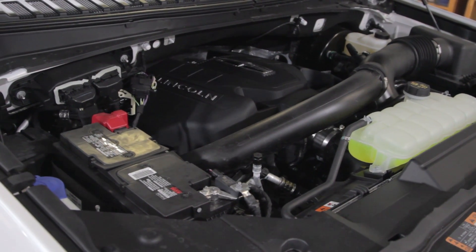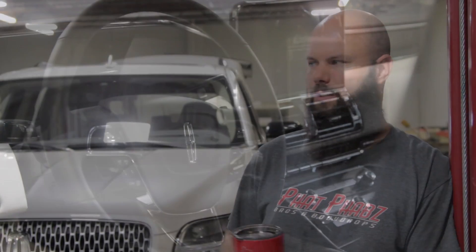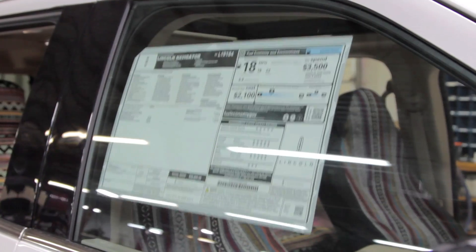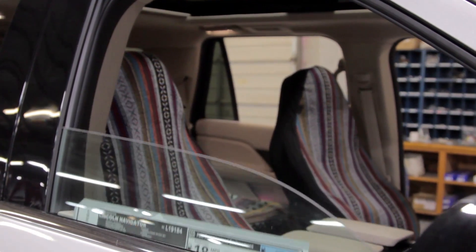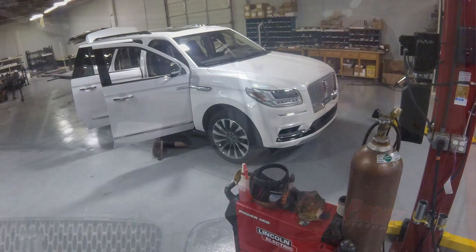Build plans include a full bumper-to-bumper chassis we'll hand build here in the house. Aluminum wheel tubs — it is an aluminum body vehicle, so everything's going to have to be done in aluminum. We will be running 16-inch Wilwood disc brakes front and rear. We are going to powder coat the chassis and mount the AccuAir CVT inside — it'll be visible. Since they're so quiet, we're going to mount it inside because the underside is going to be packed full of suspension, fuel cell, and everything else.